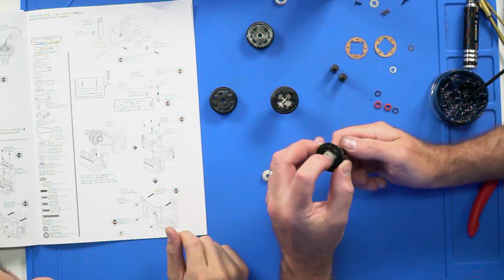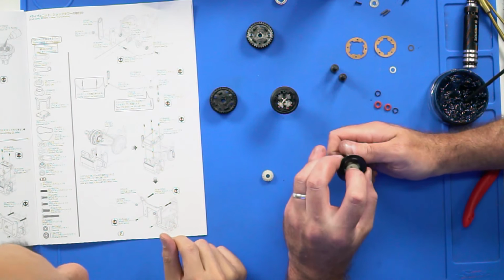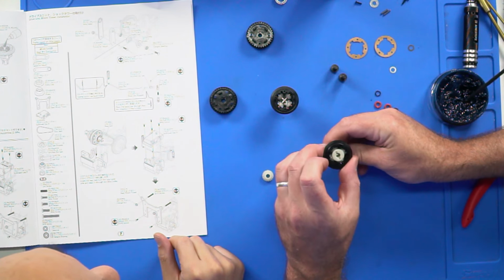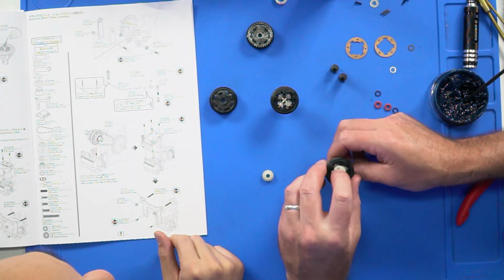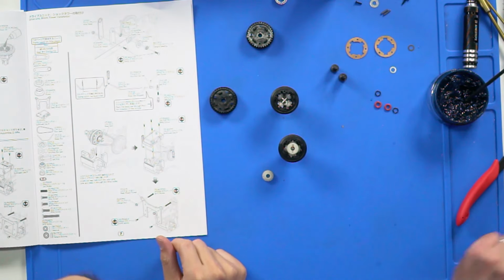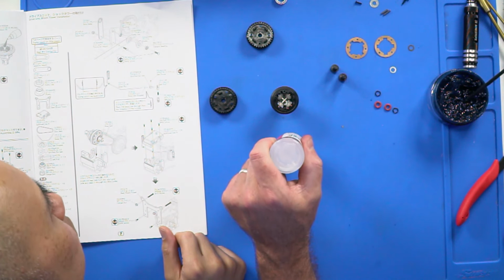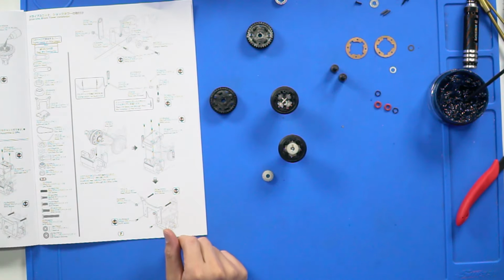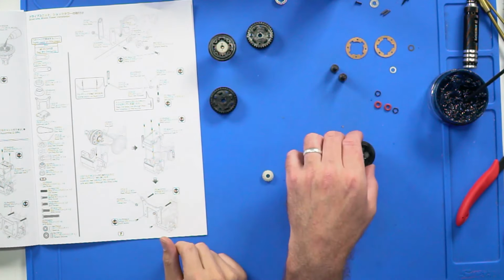Like I said, I'm just rocking the tooth mesh, making sure everything's in there, which it is. And then I'm going to line up that pin as a reference point for when I drop that case on. Like you said, the outdrive is up and down, so it's absolutely 180 degrees with the pin. And I might just put another little drop of oil just across there, in the back there. So that is diff numero uno.